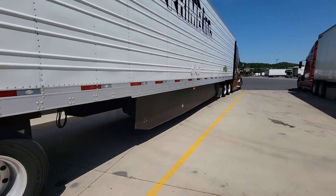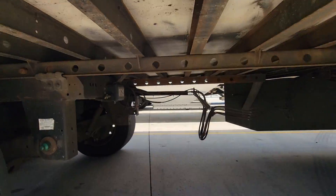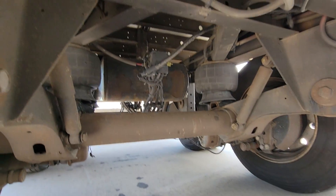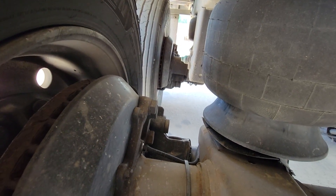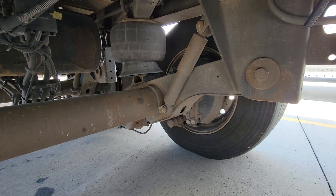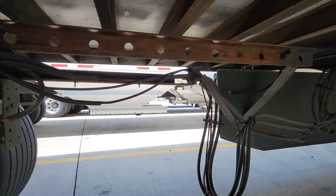I'm going to check the rear axles by going underneath the trailer here — all looks good, I don't hear any leaks. Checking the airbags, the inside walls, all that good stuff. Spare tire looks fine, cross members are looking good.